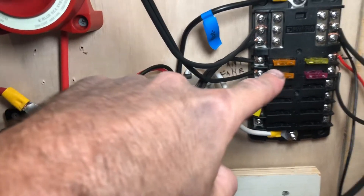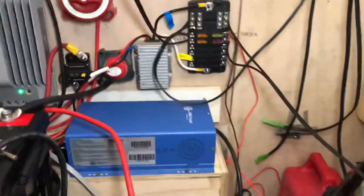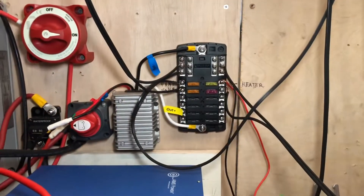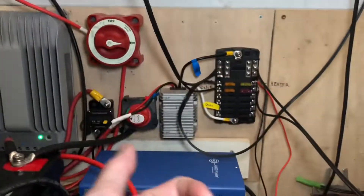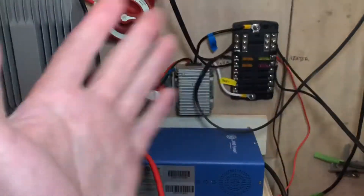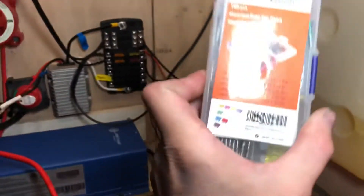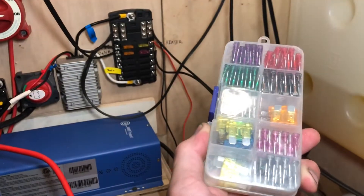I've got fan front, fan rear, and the heater connected to it. I haven't cut the heater wire yet because I need a little on/off switch working its way in there. I've got my lights hooked up with a little 3-amp fuse. That's not everything yet — I've still got wires for the shower light, rear right light, tube pumps, sink pump, and all the cabinet lights still to be hooked up. So it's a good idea to get a little smorgasbord of fuses — color-coordinated amperages — just a whole kit of them.